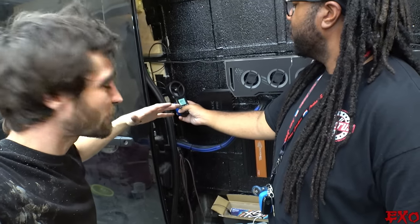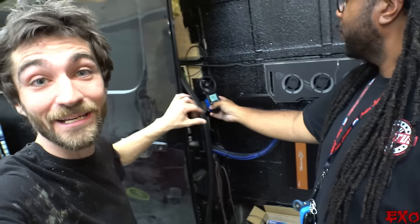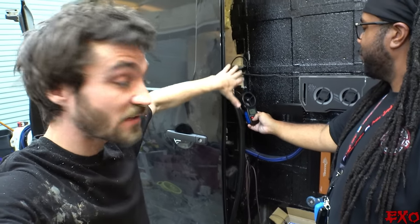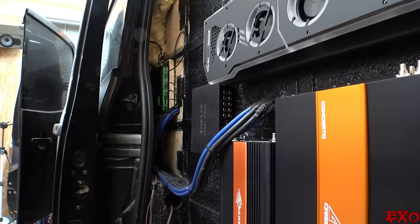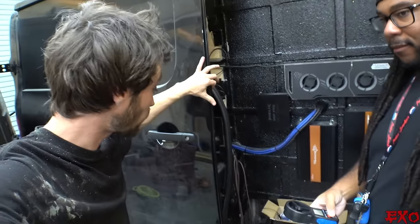We're hovering right around the 1100 feet per minute mark. So with that figure, we can actually calculate, because of the size of this opening, the exact CFM. We're about 5-6 feet away, and of course it has that one obstruction to go through. So I'm pretty impressed with how it's performing. So let's go ahead and do a quick math problem.